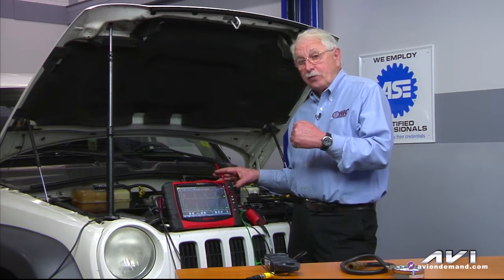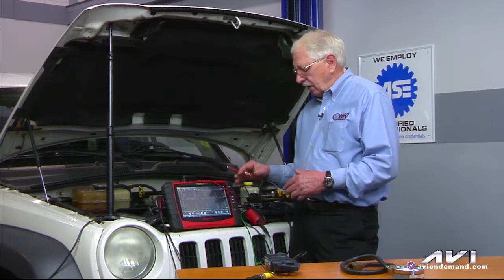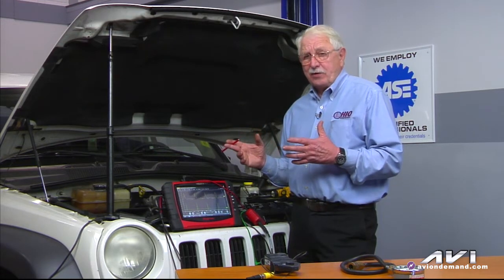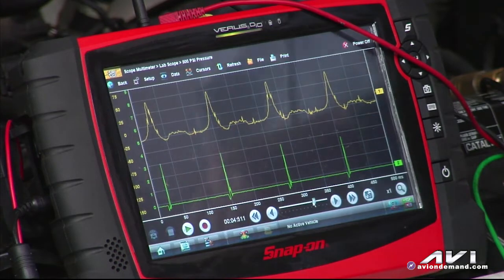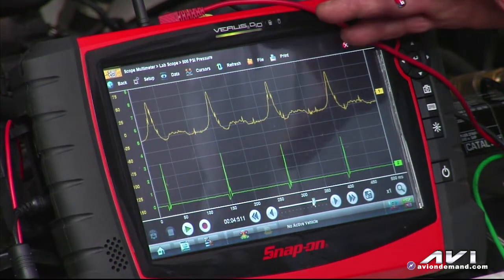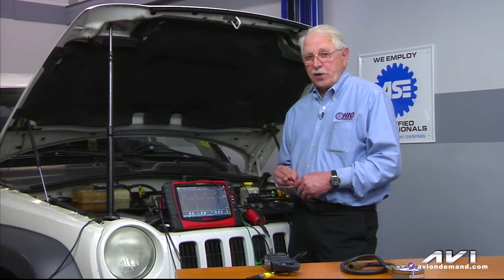What we're going to do is move on to the cruise compression. What you'll see on a cruise compression is that barely off idle — let's say about 1200 RPM — you'll actually see the cruise compression be slightly lower than what you are looking at now captured during idle. So let's go ahead and do the cruise compression test.